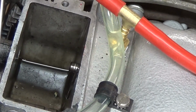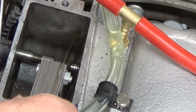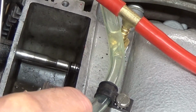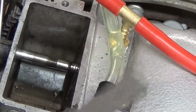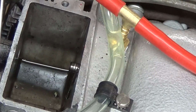And here, on my belt sander, I just took the burr off the edge. Now I'm going to put our feeler gauge down in there, and hold it tight, and then pull the feeler gauge out. Well, we still got a little bit of a drag there. You heard it snap when I pulled it out. So I'm going to hit it a couple more times.